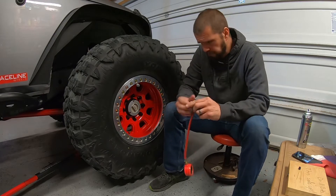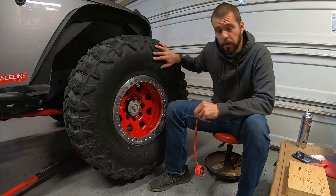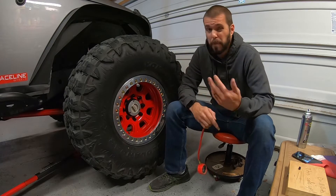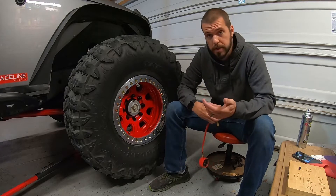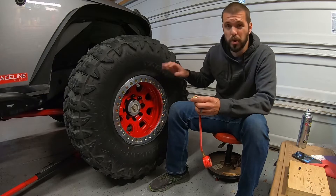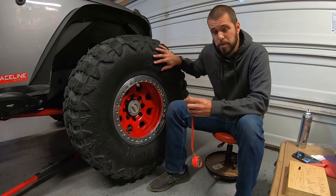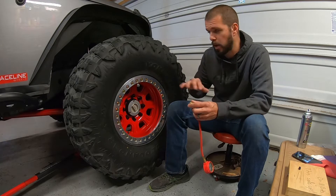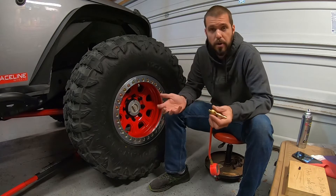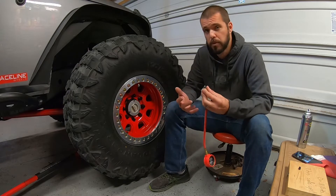Something to discuss first is the weight rating of a tire. This 40 by 13.50 is a D-rated tire, meaning the sidewall is tougher and the overall tire is rated to carry a higher weight. Typically the bigger the tire, the bigger the vehicle and the more weight it can hold. Because it's D-rated, I can air it down pretty far — if you aired a Honda Civic's tire down to this PSI, the rim would be on the ground. On a tire like this, because it's D-rated, I'm going to air it down to about 5 to 6 PSI, which is where I normally run it on the trail. At 5 or 6 PSI I still have pretty good ground clearance and a gigantic footprint.